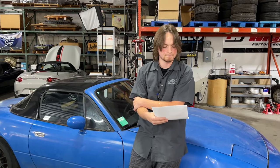Lastly: is electric cruise control worth adding if your car didn't come with it? Probably not, at least in a Miata. Most aftermarket electric cruise control kits don't deliver the same performance as factory cruise control would. Most, if not all, US-spec NA and NB Miatas came with the physical wiring to install the factory cruise control — possibly not Mazdaspeed models. So rather than an electric kit, find a salvage parts dealer and get a known-good factory cruise control kit from a stock car.